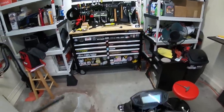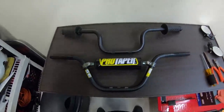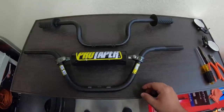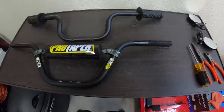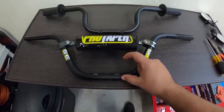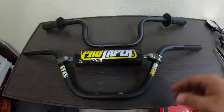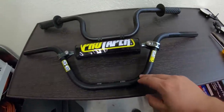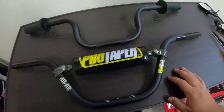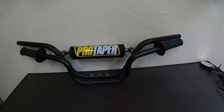Let's compare — these are the stock bars and these are the Pro Taper XR 50s. Very similar, but I think these are actually taller. A lot of people order the Pro Taper KLX 110s, which are a shorter bar, then buy risers — and a good set of risers runs about $60 to $100. Instead of doing that, just order bars with the right height. I checked the measurements and these look right. They are a little wider — I may trim them down a little bit.